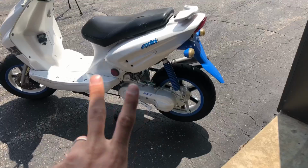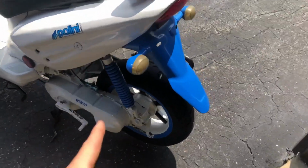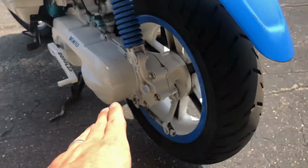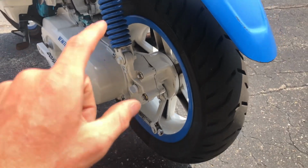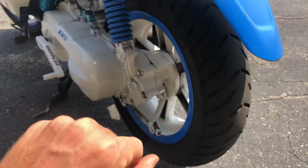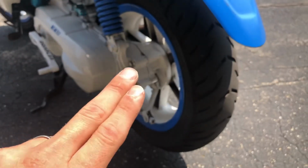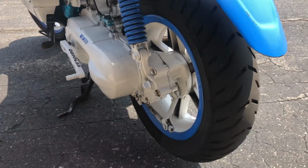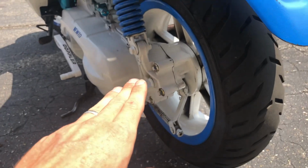It works. 2 problems. We had the gasket and we had the hole in the block. Dave at Scooter Tuners. Shout out to Dave, man. He has helped me out and gone out of his way so many times. He made a gasket. When I say made, he cut one out from gasket paper with a razor blade and fitted it up to this block. And it was a factory picture perfect gasket. I don't think anybody else could do it any better. It was flawless. So we put it in there, we tightened it up.